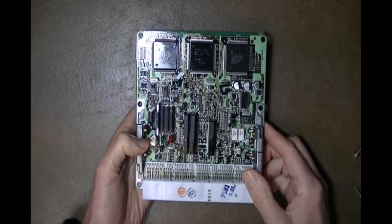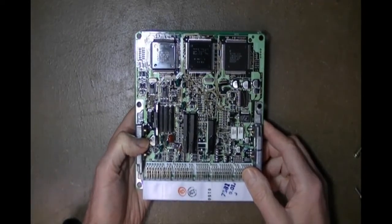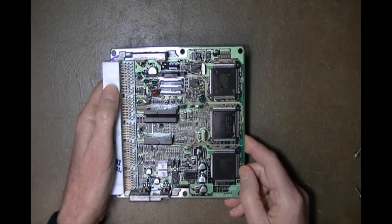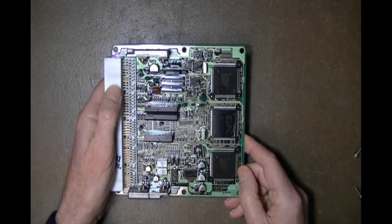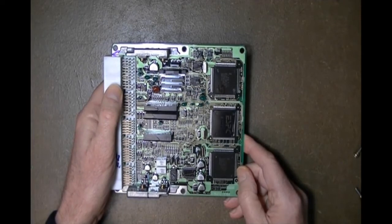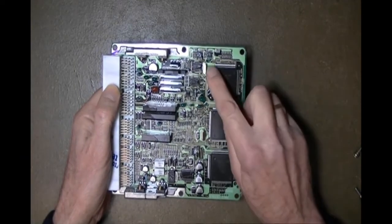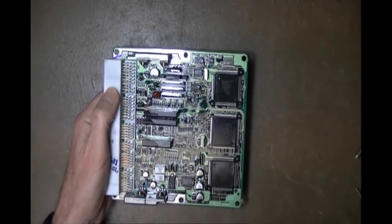We're going to focus on one eight-pin EEPROM — that's a 93C56 part — located at IC900. Whenever you have an ECU-based immobilizing system, the IC is going to be IC900 in almost all cases, and in almost all cases it's a 93C56. The part to which we're going to attach is that eight-pin EEPROM right there.